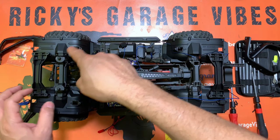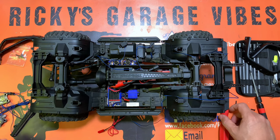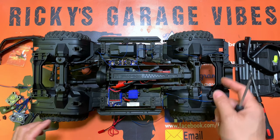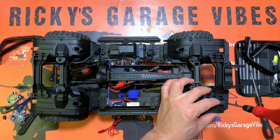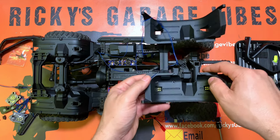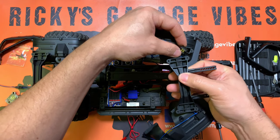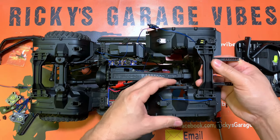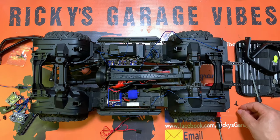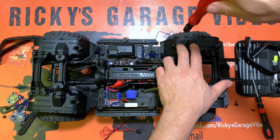Let me show you how to run the wires and lights around the Defender 4. I'll screw them in one at a time so you can see. One important thing — remove the fender from the body first; once it's off you can rest it on the truck or lay it down to get the lights around very easily. Everything is resting in place right now. You've got to remove one of the screws at the back so you can slide the wire underneath, just like that.